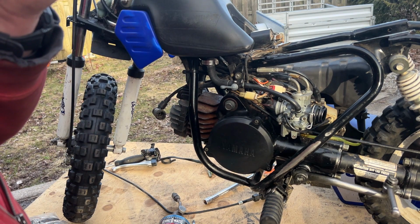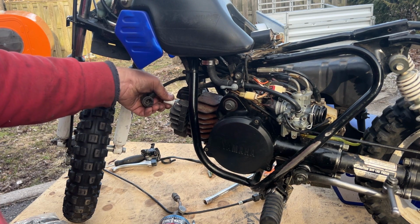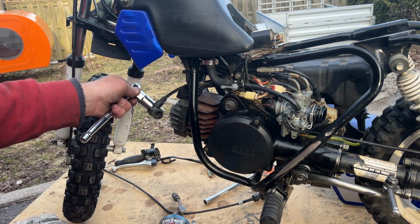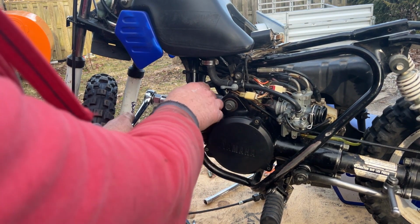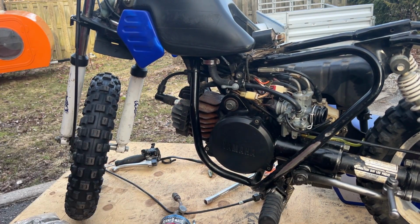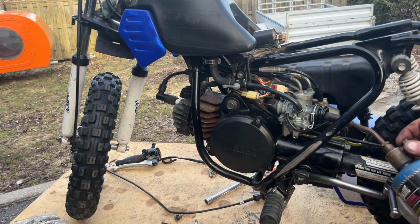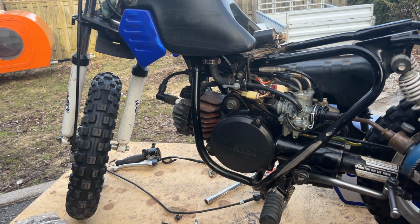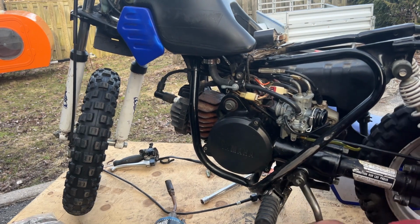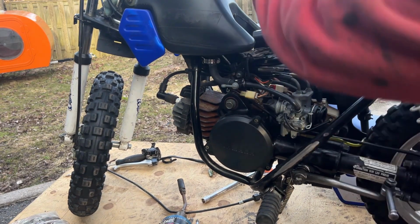It does smell like fuel. The plug smells like fuel. This fuel didn't stink, so it should still have some octane left in it. And if not, the propane should have ignited. Try you again with some propane. Throttle a bit so some propane can get in there. Was it me, or did that sound like it was going to start for a second there?